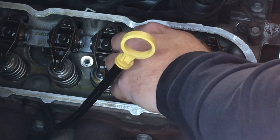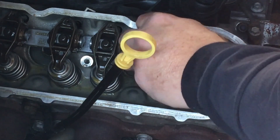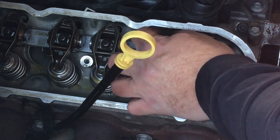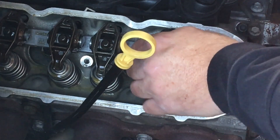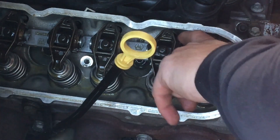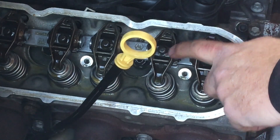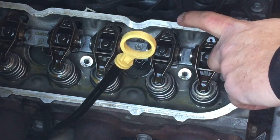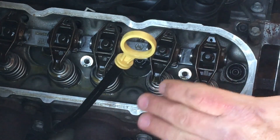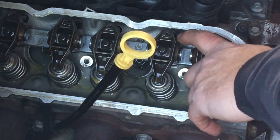Keep in mind: you can never rotate this engine with your push rod checking tool in the engine. What they want you to do is just finger-tighten this down while checking for rotation on your push rod. You want to get this bolt to seat, and that push rod still be able to spin — because what you're trying to measure is with your rocker arm fully seated in the pedestal, what gives you zero clearance between the rocker arm and the push rod. Then you add whatever preload you want: 50, 60, 70, 80, 90, or 100 thousandths.